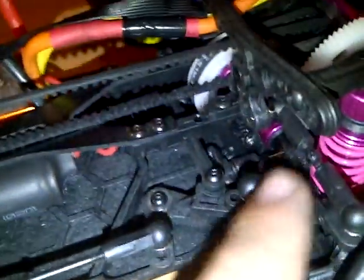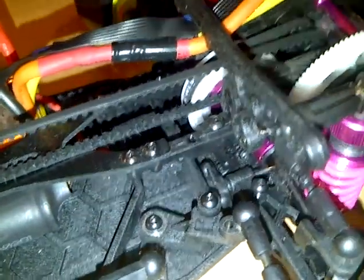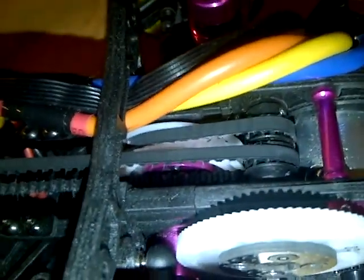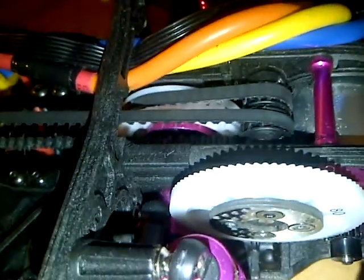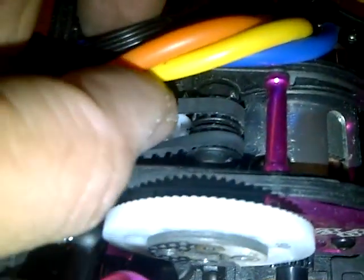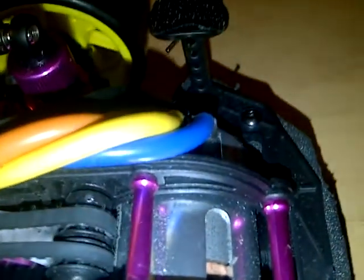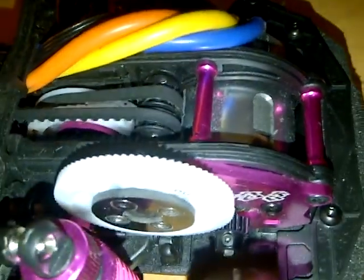Here's the worst. It has adjusters for the actual diff so you can move and shift it to tighten the belt. Well, it's at the max setting and there is still a little bit of play in it. I didn't know that at first — I never set that and just left it at the factory settings in the book thinking it'd be okay. Well, no. The actual teeth on the belt are gone — totally gone. And I had barely run this car, so I have to get a new belt already.